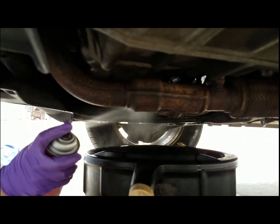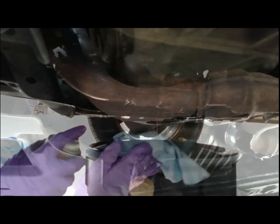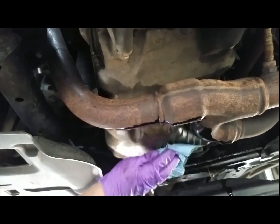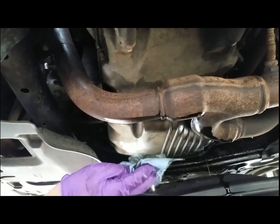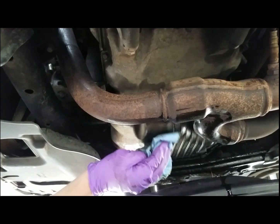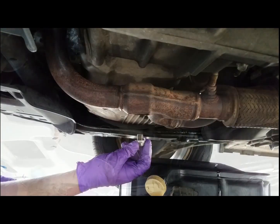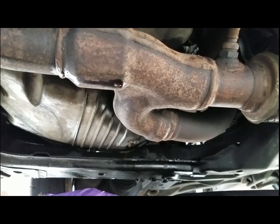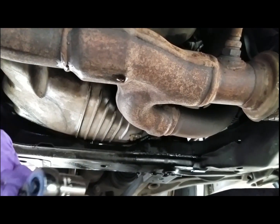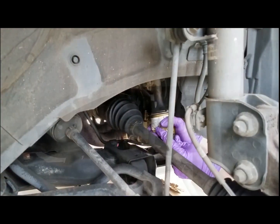And I really wish that somebody had cleaned this with brake clean. This is the first time I've really changed the oil on my wife's vehicle, but it was a mess up under there. So it was very difficult to see where the oil was leaking from. So I went ahead and cleaned it up so that we could discover where the oil was leaking. Then put your drain plug back in and tighten with your 17mm socket.